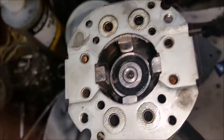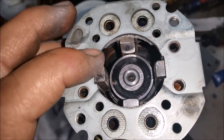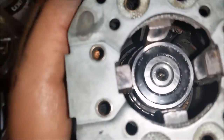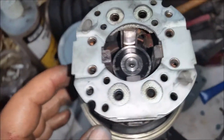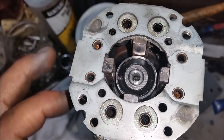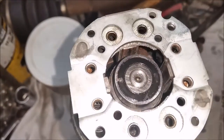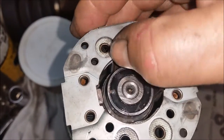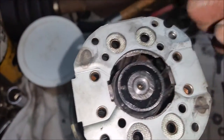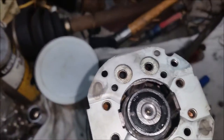The first thing you have to get it past is the bearing. Once you get past the bearing, you can cock it to one side and go around the commutator — or armature, whatever. You'll need a couple of fingers to do that. What I did is I rocked it to one side, got one side in, then got this side in, then leaned it over and got this side in and pushed my finger over and got the other side in.